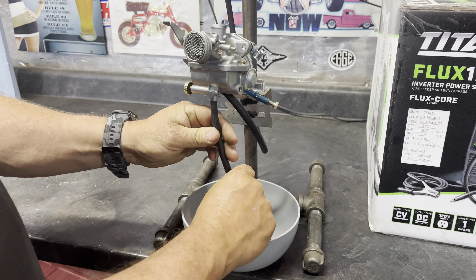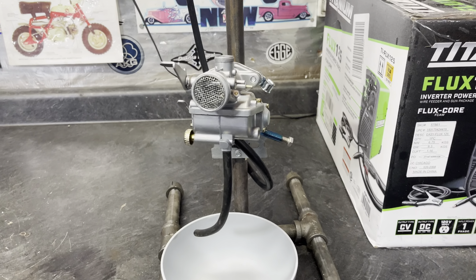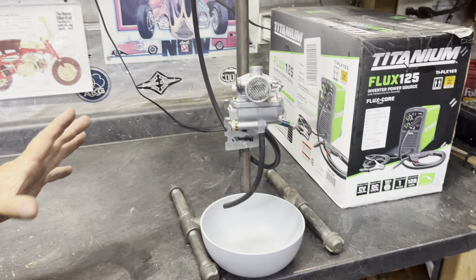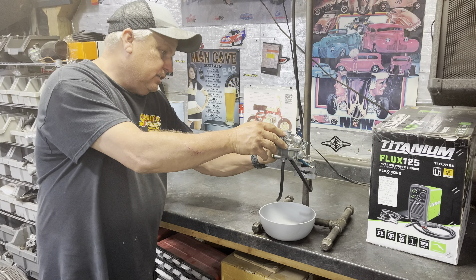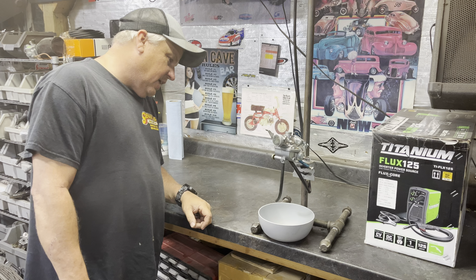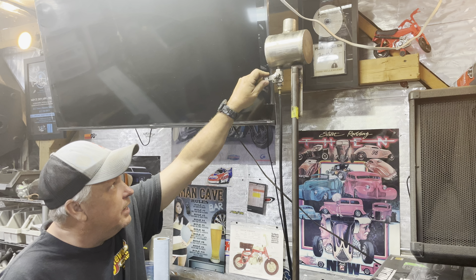What I do is, after I do these carburetors, I let them sit overnight and just make sure that they're not going to leak. If there's any drops in there, I've got to figure out where the leaks are. I just rebuilt this carburetor, and I'm hoping that everything is good. I'm in the S position, which I think means stop, and then there's reserve and on. So I'm going to turn this on now.